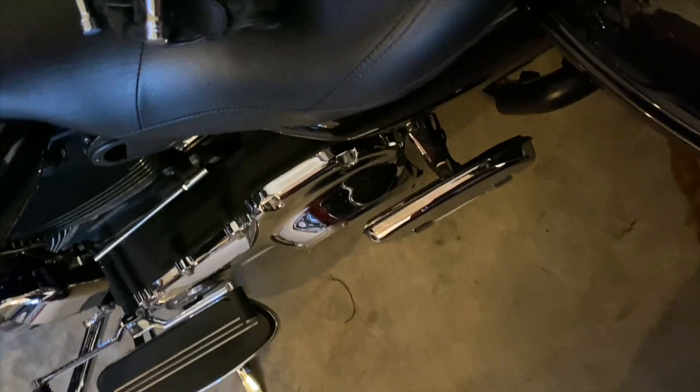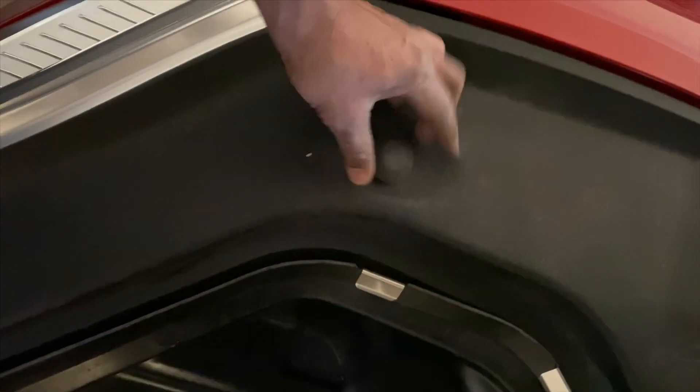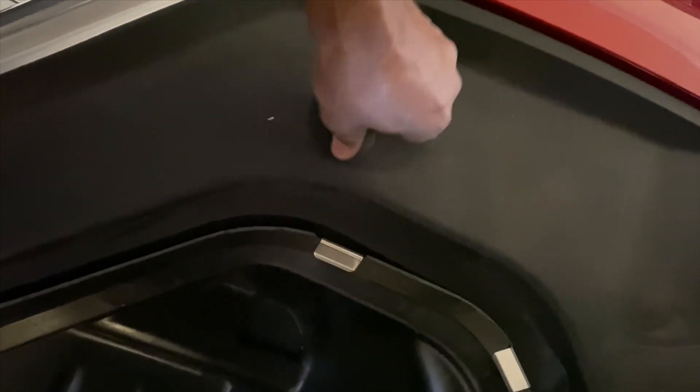For the battery terminal bolts it was either a 12-millimeter or a 10-millimeter — the bolts are tightened. For the side panels, they fit inside here with plastic clips — line them up with the hole, snap them in place, pretty easy. Then just screw those back in clockwise. I'm going to clean these off before putting them back. Only thing left is to align the other panels, pop them back in place, and then put the rubber trim back on.